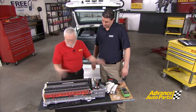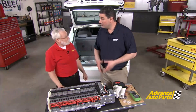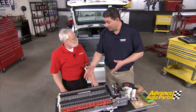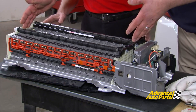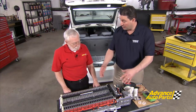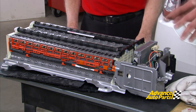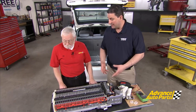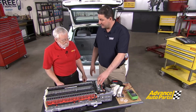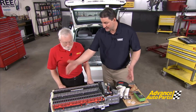Can you tell us about the plug-and-play capability of these Dorman high voltage battery packs? Dorman believes they've brought the best option to the aftermarket: a ready-to-install plug-and-play replacement. If a technician purchased a Toyota replacement battery, they would only receive the module pack and would have to transfer over all the electronics — the battery ECU and output stage relays — from the existing battery. The Dorman unit is complete with all those electronics, and it's also fully end-of-line tested and vehicle-simulated tested. That lets the technician know the battery is ready to install with no possible failures in the battery control ECU or output stage relays. They also re-initialize any ECU that needs it prior to installation, meaning you don't even need a scan tool to install this battery.